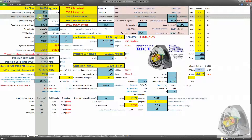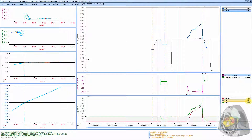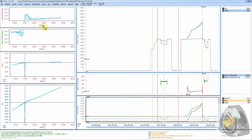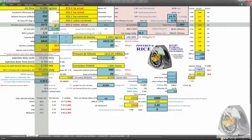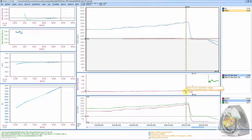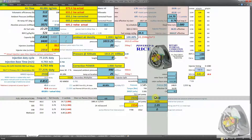Here are the parameters from today's testing. Roughly at 992 millibar barometric air pressure, we tested up to a maximum of 3570 millibar — about 37 psi. With our injector combination and the documented rising rate of 1.05, and a base of 5000 millibar, you'll see an end pressure of the pump at 7700 millibar.